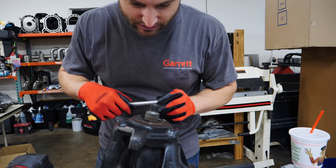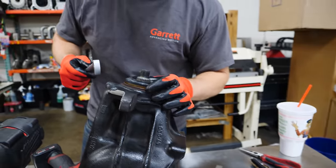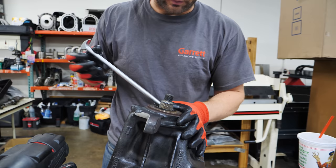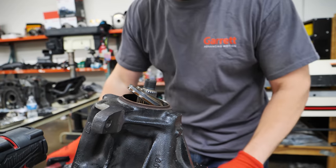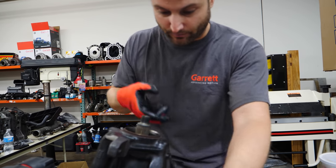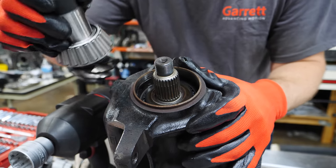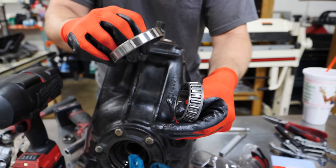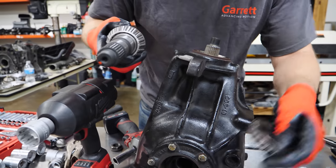We are one step closer to rescuing the pinion from its current trap. Now this piece should be something like one of these — those two are on each of the legs, so each of the wheels, and then this is the input right there. You can't take the pinion out without taking apart the rest of the diff — it's really impressive. One of the bearings is right in there; that's the other side of this one. We're going to try really hard not to damage these, even though the nature of this process kind of damages the ones that are in there. This will press fit onto or inside the case, and then this of course goes onto this piece here.